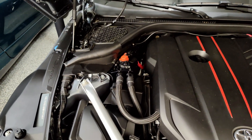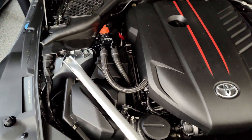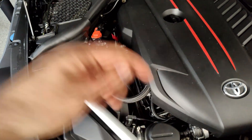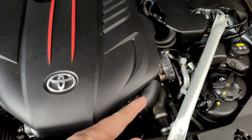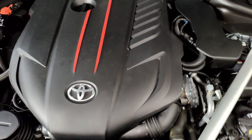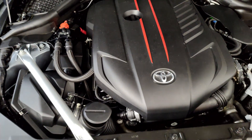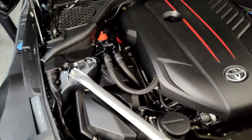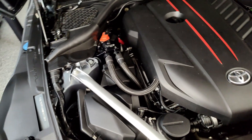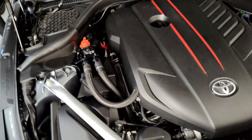It's a little peace of mind that you're not dragging trash from inside the crankcase back through your intake track. If oil gets sucked into the turbo, it gets pressurized and makes your entire intake track dirty. The intercooler is built into the intake manifold here, so you don't want oil and garbage going back in there. Additionally, this is a direct-injected engine — direct injection engines are notorious for carbon buildup on the valves — so you don't want additional oil vapor making that problem even worse.